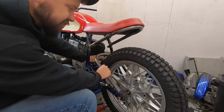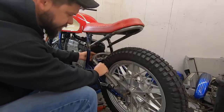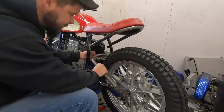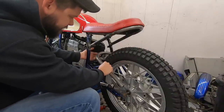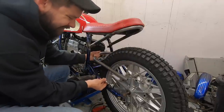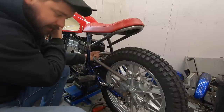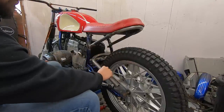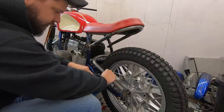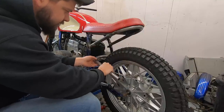If I want this to be adjustable, I need that mount to articulate at least a little bit — able to move back and forth, but no side-to-side or vertical movement. That's because if I can change the length of these — unbolt it, twist them out a couple, put it back in — that will allow me to dial in the ride height exactly where I want it. But I need the front section to move with it. Maybe I'll use some more of these clevis joints. I don't think heim joints would be a good solution here because they'll allow too much movement.